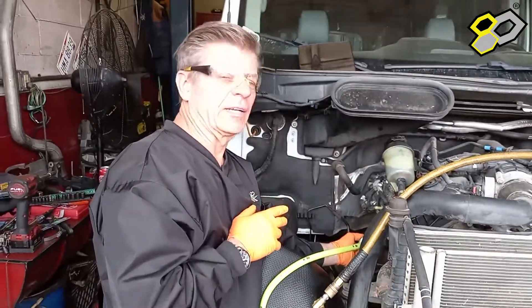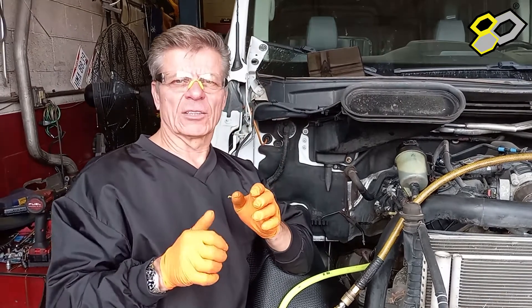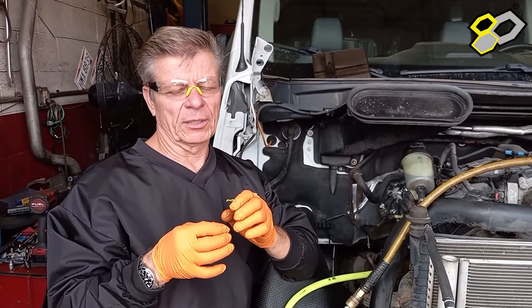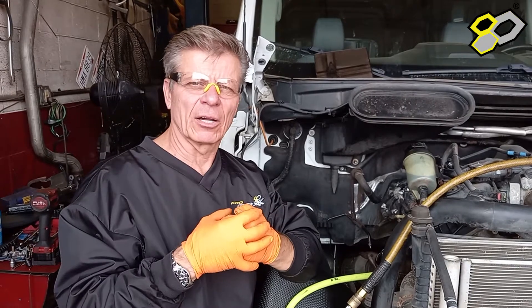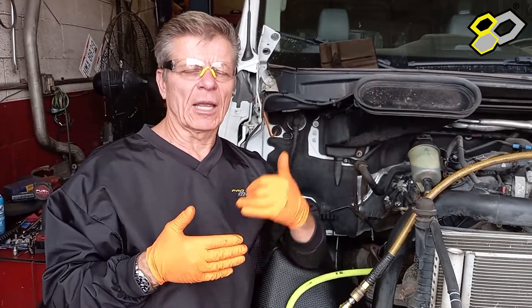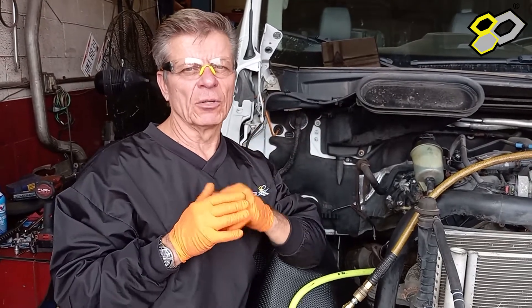With the 188 platinum bit, where we drilled it was less than a minute. The technique is to make sure you pump the drill on and off, on and off, because that divot is extremely important — when you load the bit equally across the cutting edge, you get better cutting efficiency and longer bit life. If you try to go right away without creating that divot and bumping your drill on, you're going to limit both the bit life and its cutting capability. This is in the instructions, so make sure you read it.